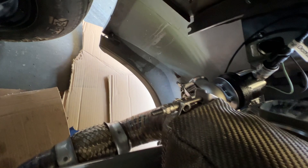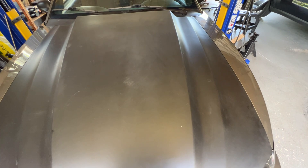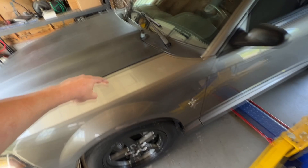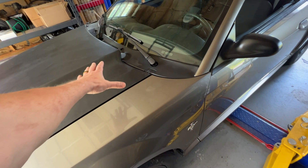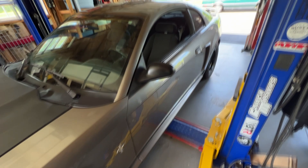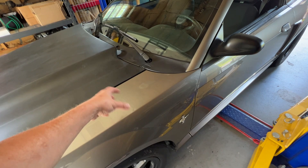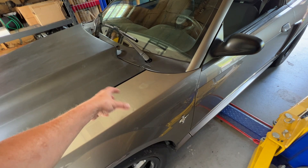The ever-shortening list — the only other thing I need is my wastegate dumps and my exhaust dumps before the firewall on both sides, so that needs to get routed. I think Tom and I are just going to do an X-pipe that comes underneath, along the converter-engine-trans centerline area, and then do dumps out in front of and behind the front tire area for now, until we decide what's going to happen with the back and mufflers. It's V-banded so we'll just go dink dink and X them — because twins can sound clappy and weird — so X-ing them should keep it sounding smooth.